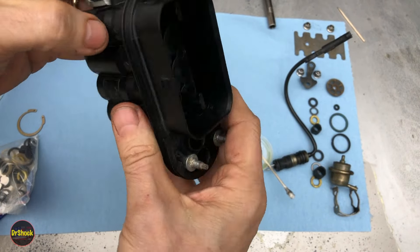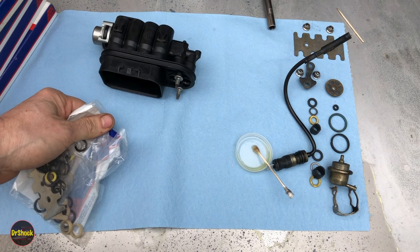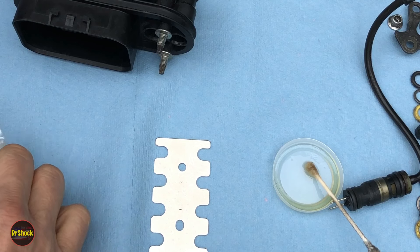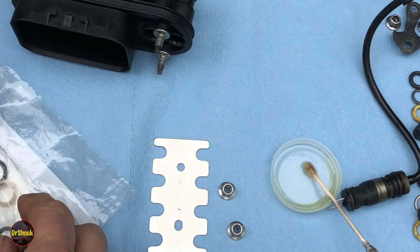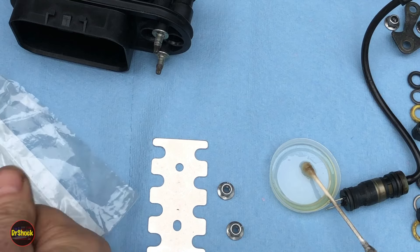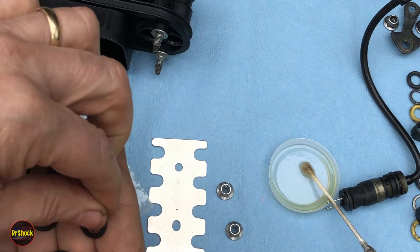With the regulator in position, the next thing is to rebuild the O-ring piece for the fuel lines, which means opening up our kit. We'll dig out the 8-cylinder plate and the replacement nuts. The black O-rings in the kit — there are quite a few — are for if you were keeping your old fuel injectors. You'd end up with several of the sizes necessary to do the top and bottom of each of the injectors.